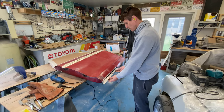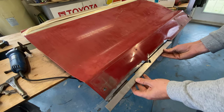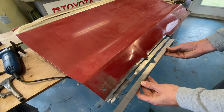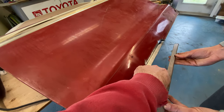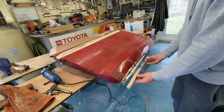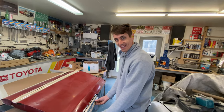Jordan and I have been working on this patch that goes the whole length of the door. We figure it's easier to do it in two halves. We've removed the old steel — this is all brand new underneath here, which we did last time. Now we're going to put some weld-through primer in there and I'm going to teach him how to do a butt weld. Are you excited? Nice.